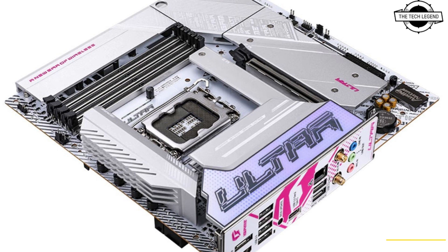The processor is wired to a PCIe 5.0 x16 slot and M.2 2280 x4 slot. Colorful uses the rear of the PCB next to 4 DDR5 memory slots, where you would normally have the 24-pin and other connectors. There is an additional M.2 slot hidden behind the heat sink and yet another M.2 slot between the two PCIe slots.